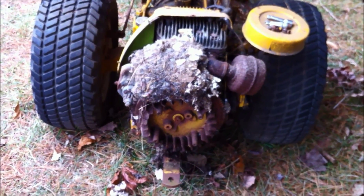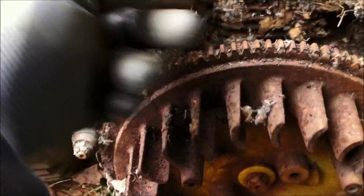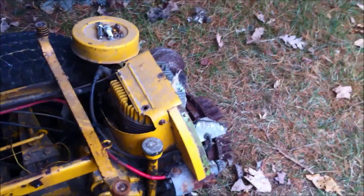I think we've got a mouse nest in this engine — holy crap, look at that! This needs the backpack blower. The starter is stuck up and there's a wire for the ignition caught in the ring gear. It looks like the Bendix drive on the starter is shot — probably going to have to take it off and clean it on the bench. But the motor itself is turning over freely, which is good. The Bendix eventually went down — probably needs a bunch of oil. The mouse nest debris is all in the teeth of the ring gear.